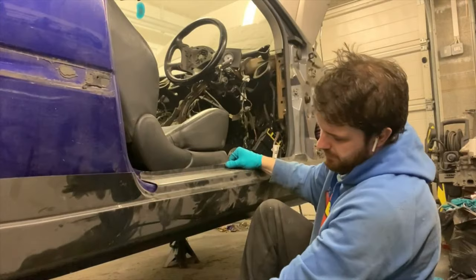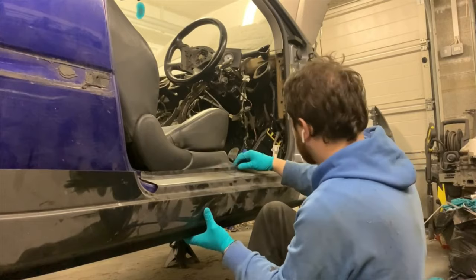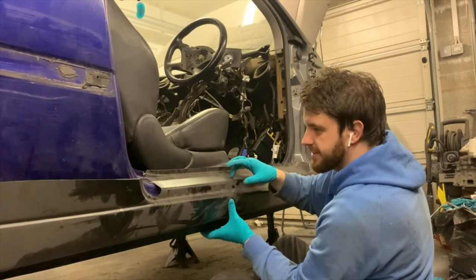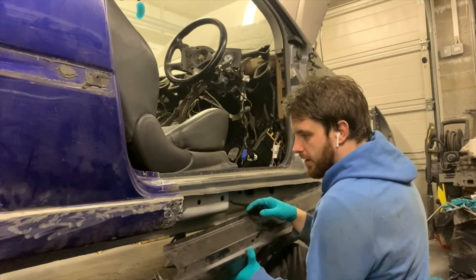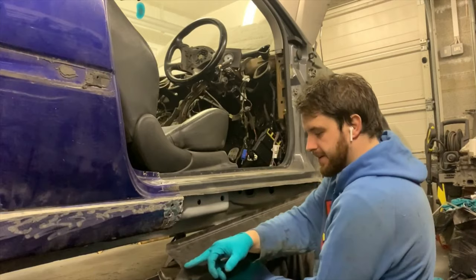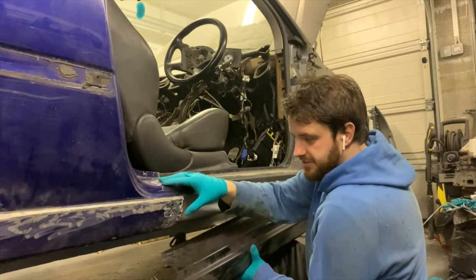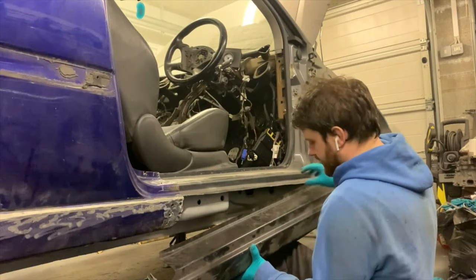We can dispose of the back, and then cut it along here somewhere, and then we'll see if we can fit it back up after fitting it under here. Because I'm not using this, as there's nothing wrong with this bit here. So yeah, cut this down here, fit it up, cut it along, start again. Cut it down here, cut it along here, fit it up. Without the rear wing in, and then trim it so I can weld them both together.